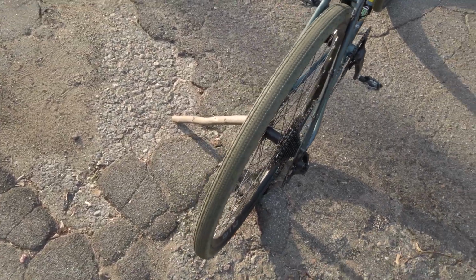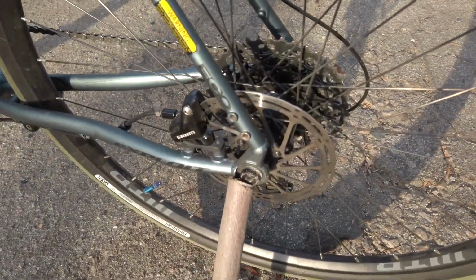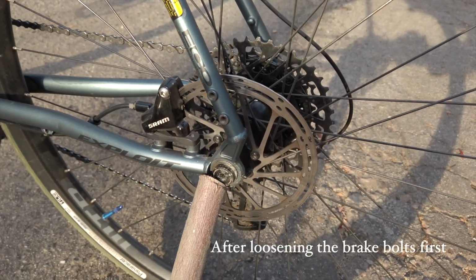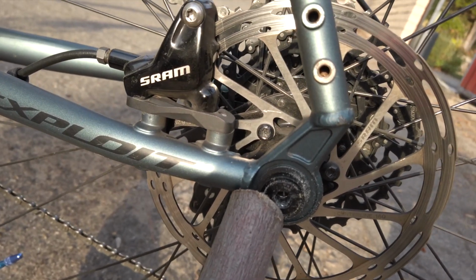The other thing of note is when I switch tires, I have to adjust the brake caliper. There's a slight rubbing, because the tolerances aren't exactly the same on the disc. So I basically just spin the tire, squeeze the brake handle a couple times to get it lined up, then squeeze and hold, and retighten the caliper in that position. That gets rid of the brake rub.